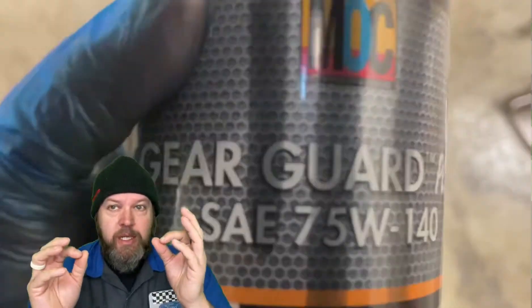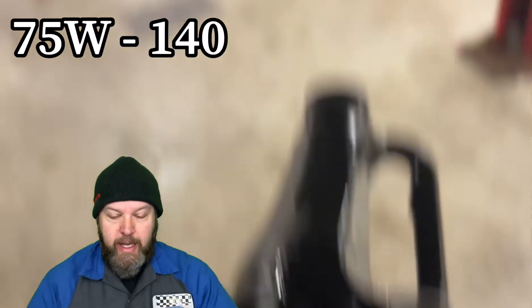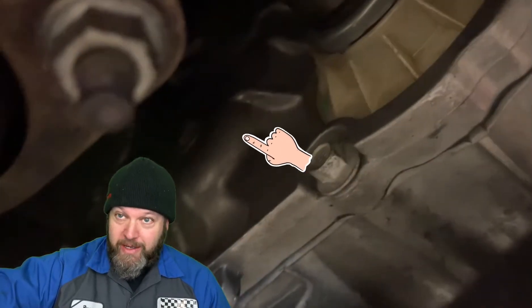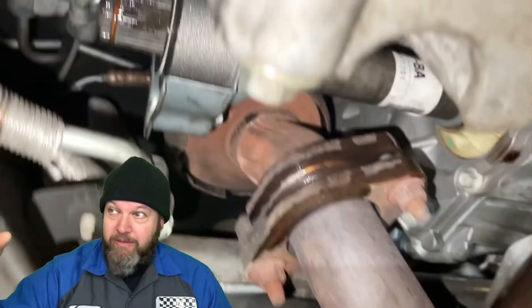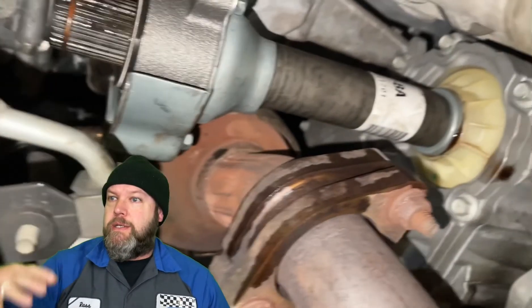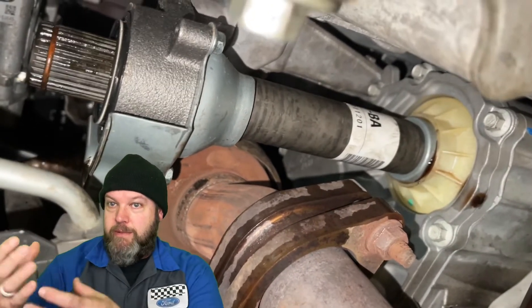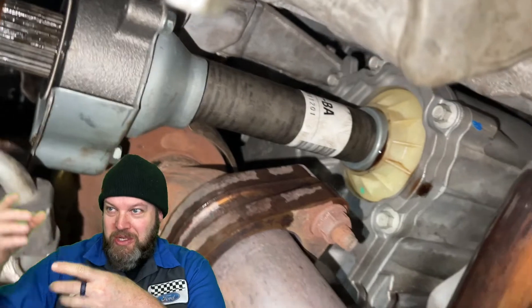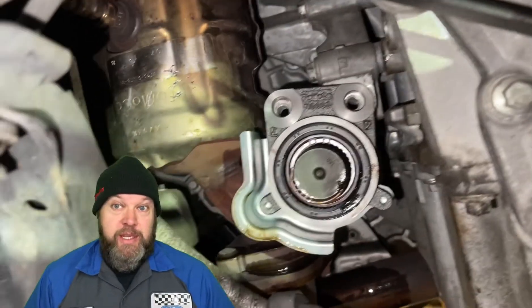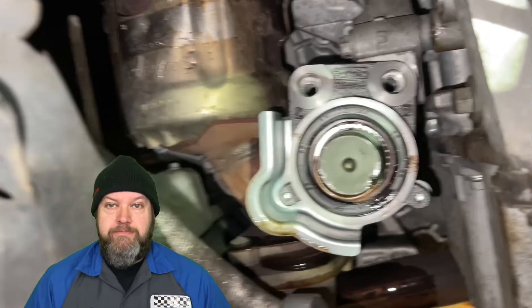You're going to have to replace the gear oil. Here's the gear oil I used. Towards the back of the transmission you're going to see a little plug — an Allen wrench screw. You unscrew that and fill it to the top, to where it's not going to drain out anymore. I squeezed it in with a little hose. Once it starts pouring out, you know it's full. Put the plug back in, put the CV axle back on, and you're done. It's that simple.